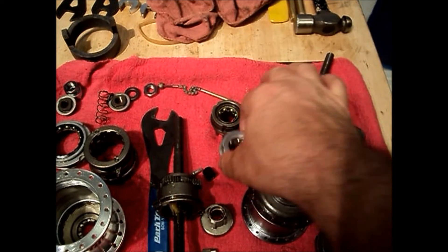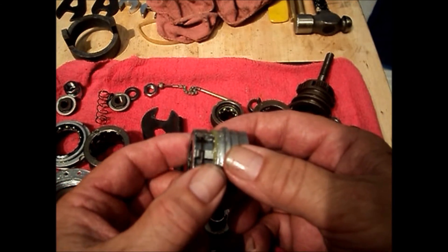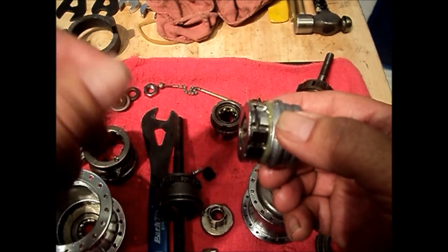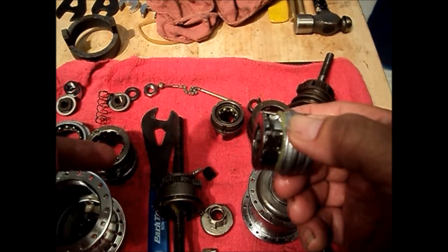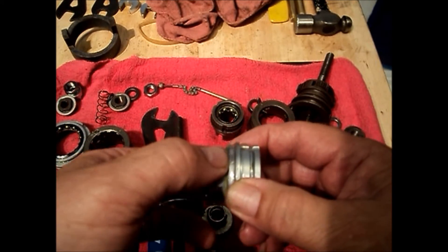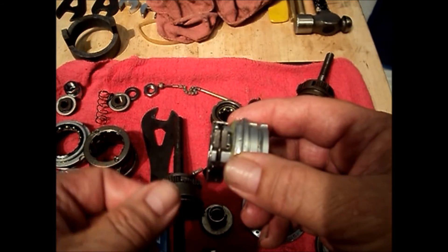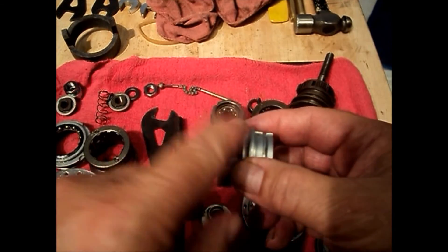What we have in effect is basically a fail-safe system. When third gear is engaged and the clutch has engaged the planet carrier, the power flow goes from the driver to the planet carrier to the ring gear. Since the ring gear is overrunning the driver pawls, the ring gear will ratchet over these pawls — so you'll hear a more pronounced ticking sound in third than in second. That is unique to this redesign; the older hub didn't do that because it didn't have these pawls.